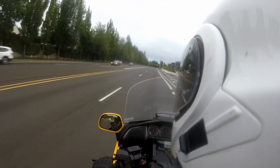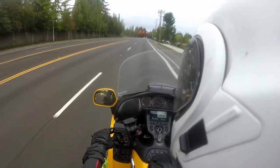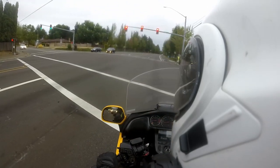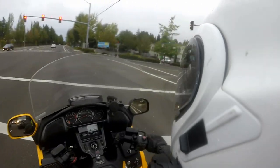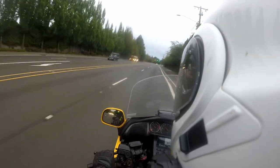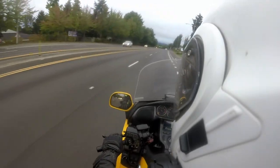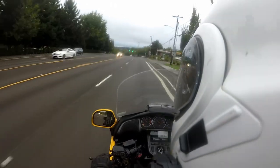I wonder how this rear tire will do with the bump up here — I usually avoid it because I know it's there, but I'm going to hit it today. I put a traction dynamic spring in the front forks when I rebuilt them, but I've done nothing with the back. I'm curious how the car tire affects the rear suspension. There it comes — oh, it's not as jarring. Yes, it is a better ride. It seems like a lot of benefits, and the only downside I'm experiencing is it's a little different in the turns, but it seems like you get used to that.